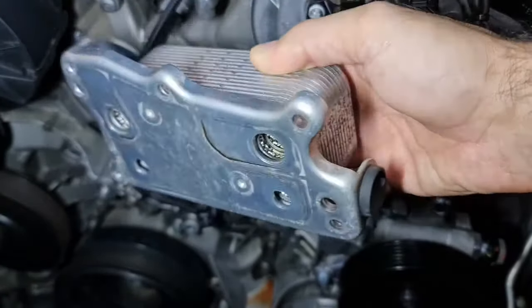And as I showed you before, there are three T30 screws in there. The only thing that is tricky is when you put this reservoir in place, there is not much room in there to see or work. So it's going to take time to put this circlip back in that groove, because there is no visibility, especially on this car with the position of the ABS pump. Okay, you can tell from the bottom of the older bottle that it has been leaking for a while, see?